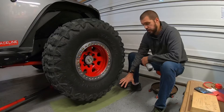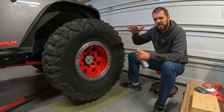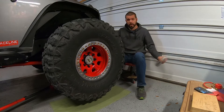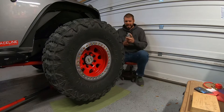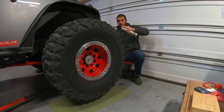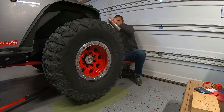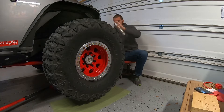We have our next piece of paper on the floor, ready to get our next stamp at 14 PSI — a great PSI for a tire if you're not going to be running a beadlock. Too low of air pressure unfortunately allows your tire to roll the bead right off the rim.